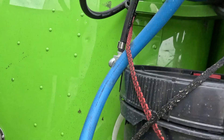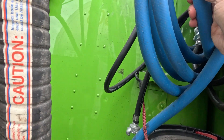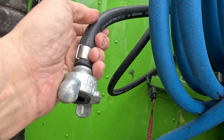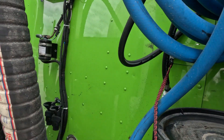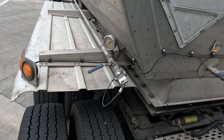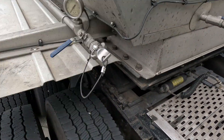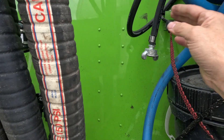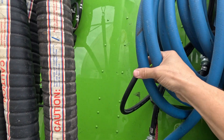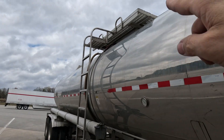So then you've got your air line here. Your air line will tie in. When you're unloading a tanker, I prefer — and I suggest to everybody — you've got your regular 50-foot, 3-quarter-inch air line. I suggest getting a smaller jumper line. I've got a 10-foot jumper line tied in. Some trailers that you pull have air hookups at the front, so if you have this small jumper line, all you've got to do is pull this small section and run right there. That's usually a little bit more easy to manage. I've got it where I can just pull it off over here real quick as opposed to trying to drag the big line. But you want the big line too if you've got a trailer where you've got to run all the way to the top.